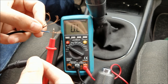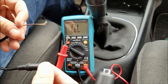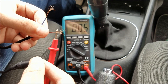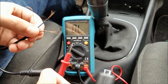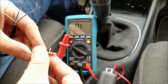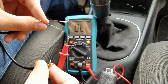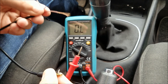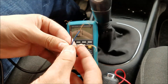We touch the blue wire — we got nothing. If we touch the brown wire, we got no resistance, which means the brown wire is in charge of the right side. Now to confirm, we'll check the ground as well. The blue wire should be ground — as you can see, we got no resistance on the blue wire, which means it's in charge of the ground.